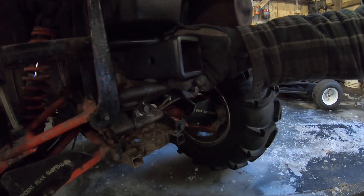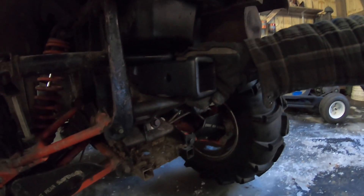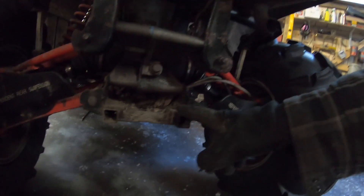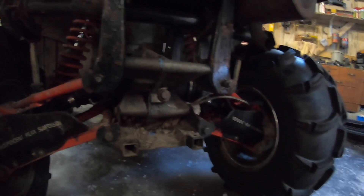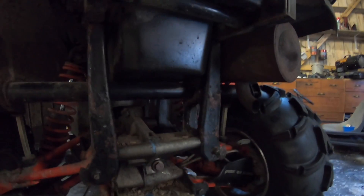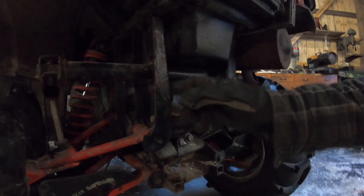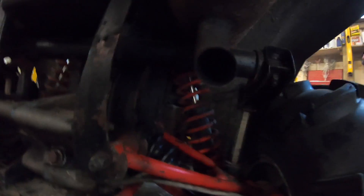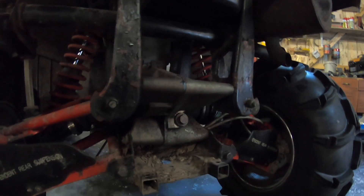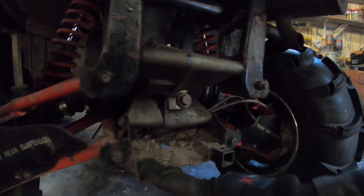So I got to figure a way to mount this on the ATV. I was looking at two different places — either somewhere down here where the old stock hitch was, or up here as an alternative. Now if I mount it up here, I'm not able to utilize these two points which run the whole length of the ATV — these two pieces of steel make up more or less the backbone or frame of the ATV. I want to use these as a point to get strength from. If I mount it up here, the only spots I'm getting strength from are these pieces that hold up the back A-arms and the sway bar. They're a little on the thin side, so I don't want to be putting a whole bunch of weight on there, especially with a two inch receiver when I'm hauling around some stuff.